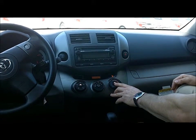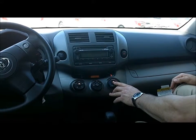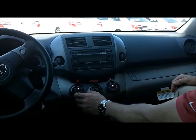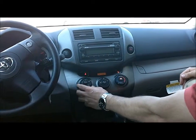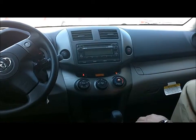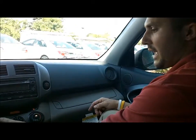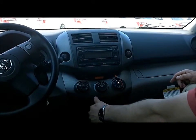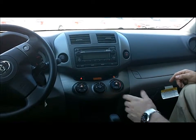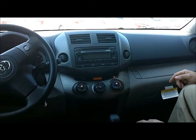It won't get cold unless you're utilizing the air conditioning system. Now, one thing I've found when people want to use defrost — if you watch the light, when I turn it to defrost, the recirculation turns off because the defrost has to use fresh air. So we cannot get recirculation when we're on the defrost setting. To get it back, you have to hit the recirculation button again to get the maximum cooling out of your system.